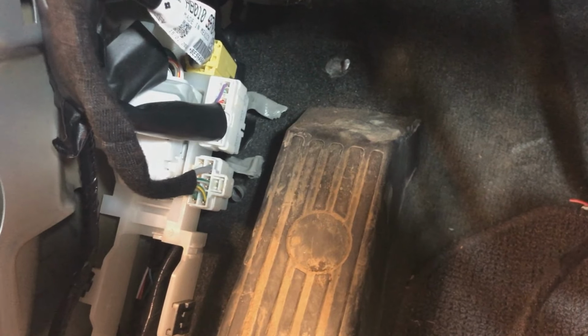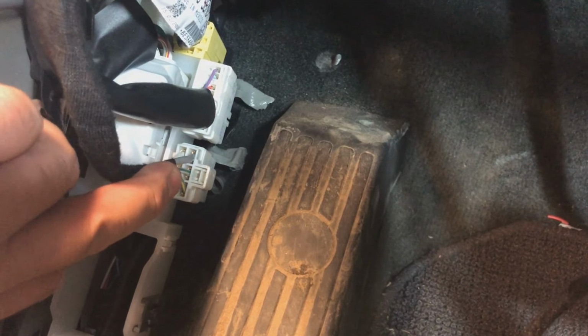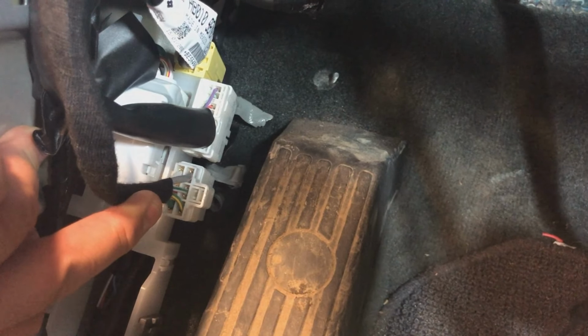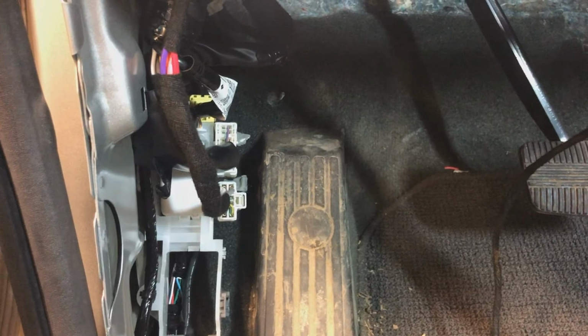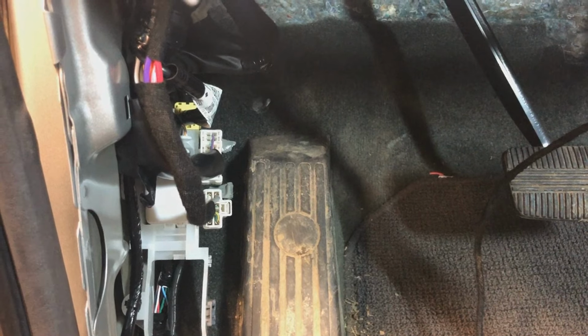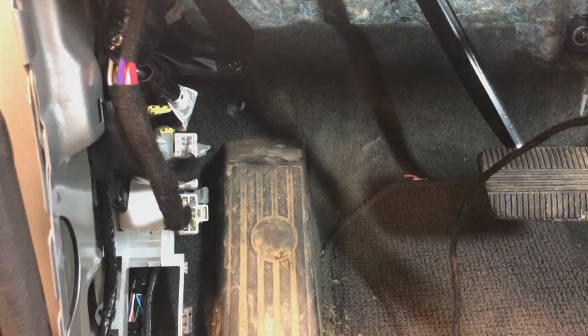So I just wanted to bring your attention back to the driver's kick panel. Like I said at the beginning here, this is actually the ignition harness. This is essentially a harness that comes directly from the back of the key cylinder. If you're an installer that goes strictly by what the documents and manuals tell you, they'll probably tell you to go here. That's the actual harness coming out the back of the key cylinder. And if anybody has tried to get up there and work with that harness at all, you know that it's almost impossible. There's no length and very little room up there to work with, which is why I do all my ignition harness connections down here, aside from second start, obviously, because once you get through here, you'll realize that there's no second start wire and you have to go to the main ignition harness for that.